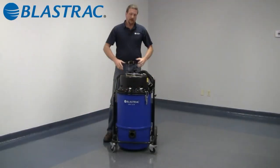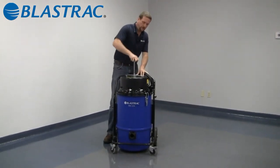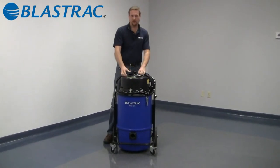The 1216 is a shaker system to clean the filter. Simply grab the shaker knob, release the handle, and press up and down on the shaker knob. That will release all the dirt and material off the filter.